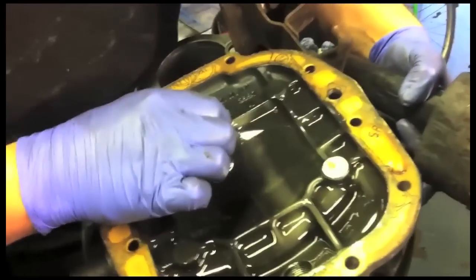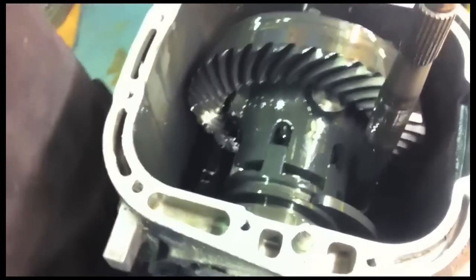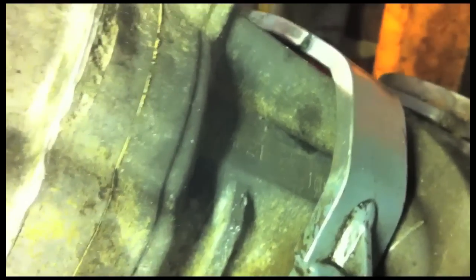Okay, we're just taking the bell housing off, and this is the first look inside. Oil throw is intact. It's not spun in the case. It's good. No chunks out of the pinion that we can see on the drive side. Okay, Aidan's just pointed out that down here there's a number. You've got AHF and 21, and then there's a 10 and a 1 down there, which denotes that it was built in October 91. Is it? 21st of October 1991.